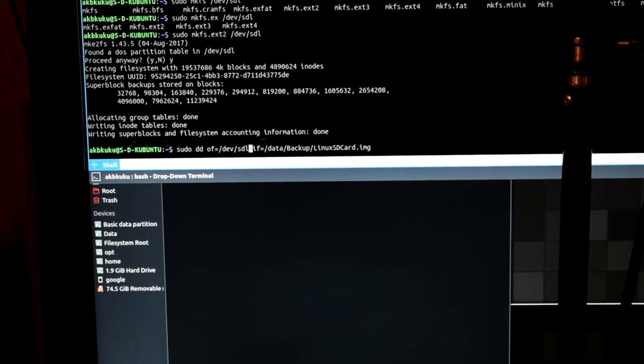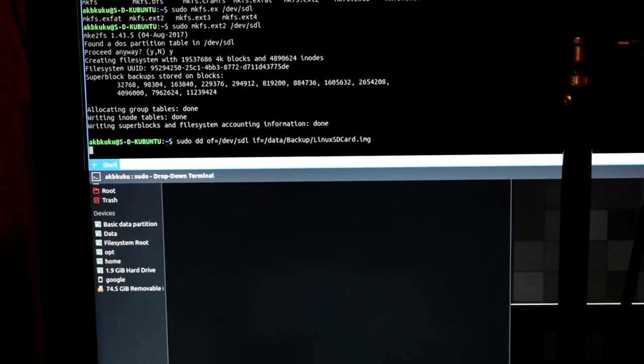Alright, in an effort to make this thing actually work, I'm going to DD a backup of the SD card install to a real hard drive, because it looks like none of the computers like the SD card to IDE adapters. Yeah, or possibly the SD card at all.